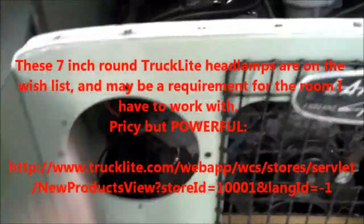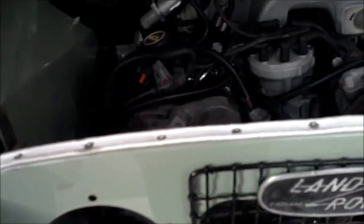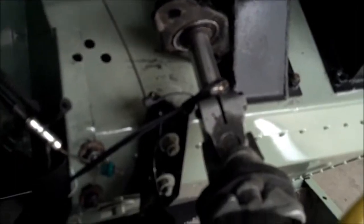I might do some adjusting to the back of the headlight housing because I think I've got possibly just enough room to have a couple of different options. One of the things that's missing is we still have not fabricated how the steering column will mount to that bracket — it's just on with zip ties. But we now know that the original Series column and the P38 column, one sleeved inside the other, is exactly where to weld it. We'll take care of that when we get it back to the shop.